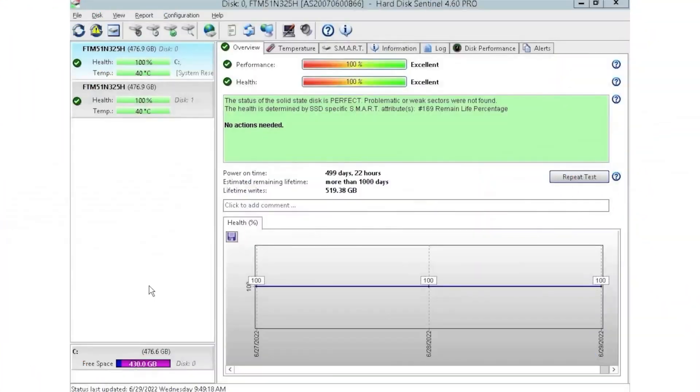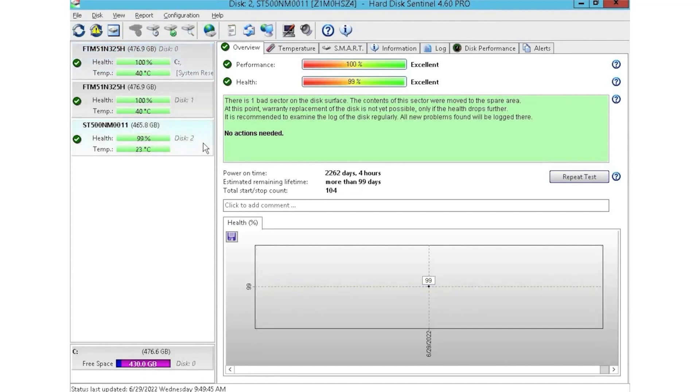Now we're going to show you how to use HD Sentinel. I have HD Sentinel pulled up right now, and as you can see we currently have two drives plugged in, installed into a storage array where we can test multiple drives at a time. HD Sentinel is an awesome tool because you can see things like power-on hours, which is great especially when buying used equipment — you can see how long that drive has been in use. You don't want to use heavily used drives because that means higher risk of drive failure. It'll automatically populate drives within the software and give you health scores. The two drives at the top have 100% health scores, while the one at the bottom has 99% — all pretty good.